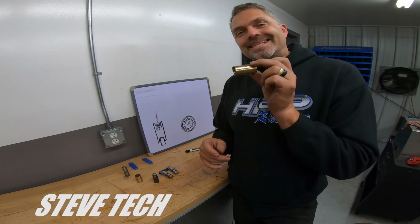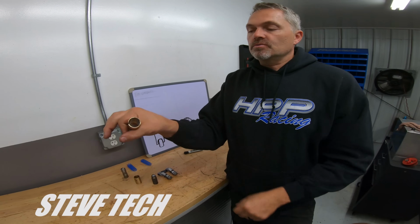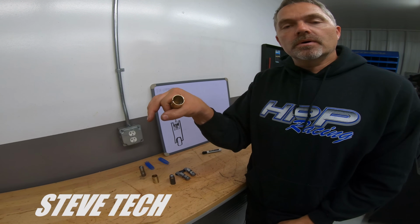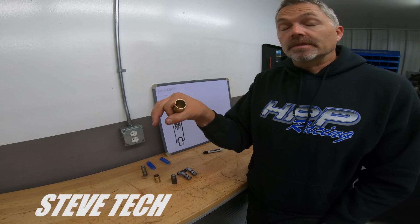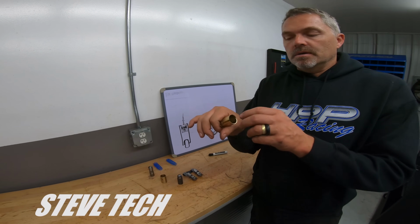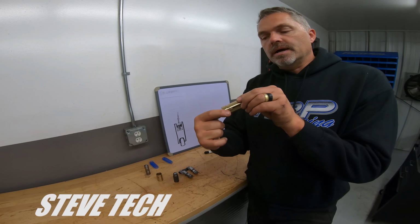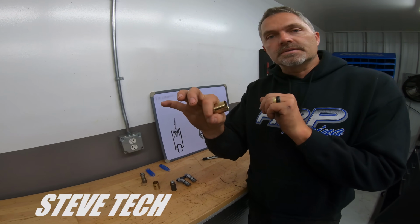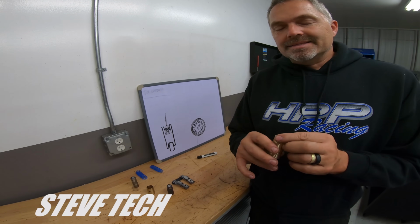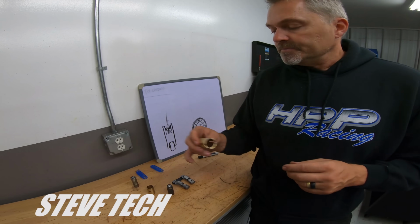And you can't take these back out. So now you have this block that's wrapped around that lifter just like this. How are you going to clean out behind that oil galley? It's really hard. If you eat up a bunch of material, you eat up parts, have a lot of fine particles, it is impossible to get all the debris out from behind this because it's all encapsulated. So that's just one of my little common complaints about this. It's not the end of the world, but it can be kind of a bugger.